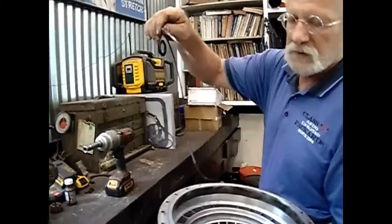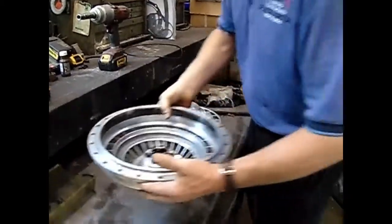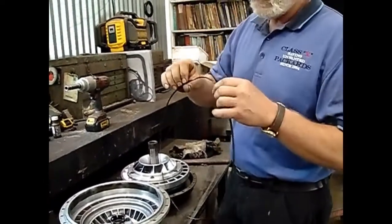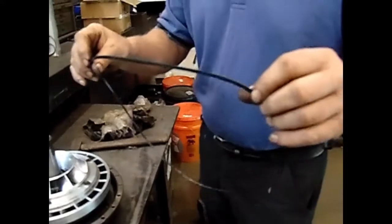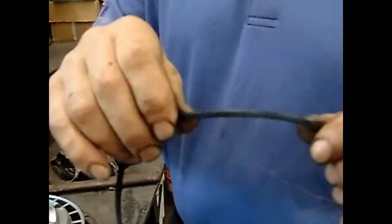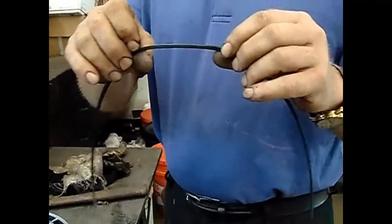These later Ultramatics are sealed with an O-ring; earlier ones with a gasket. What's the difference between an O-ring and a gasket? Aren't O-rings just gaskets? No — the earlier cars just have a flat paper gasket. The O-ring is actually superior and easier to install, but you can only use them one time because this used to be round. If you look closely you can see it's now collapsed down to a triangle, so you can't put it back — otherwise you get to take the car apart again and put in another gasket.